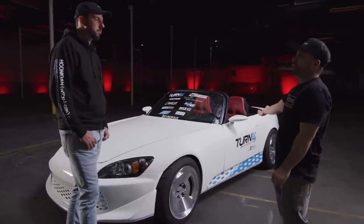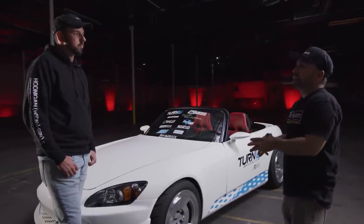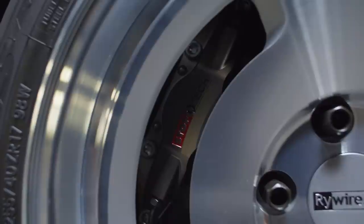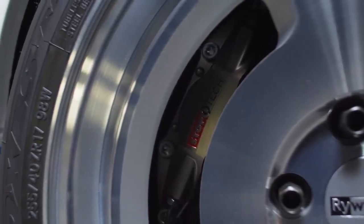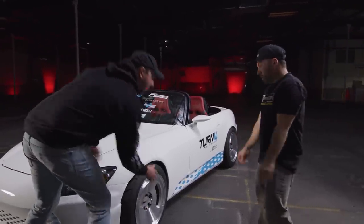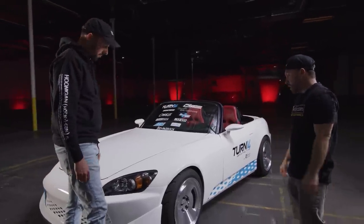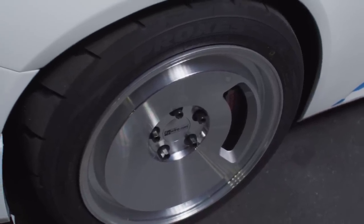When we were getting them made, the people doing the wheel were like, oh, it should actually balance okay. I'm like, whoa, there's no way. When we got them, took them to Ruin Tire Center next door. They mounted them, balanced them, and I'm like, what did you guys think? They're like, there's like three weights right here and they're fine. Because they cavitied out the opposite side and did it really thin. So there's basically like a counterweight. So right around there, it's that same cut but on the back side of the face. They just moved it over, cut that section out. That's really smart. The real only downside is these wheels are probably a little bit heavier than they could be.